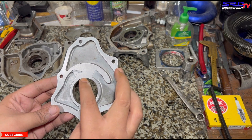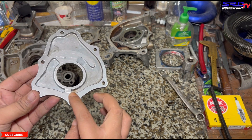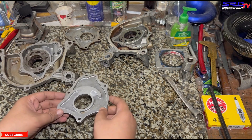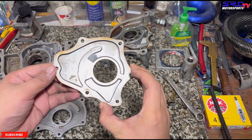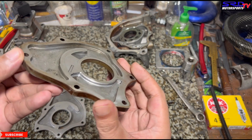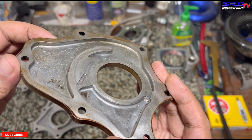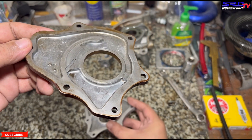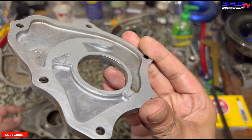All resurfaced — you can see the ridges are gone. The bottom has a deeper ridge but we didn't remove that because it would get too thin, but overall it's a lot better than before. When you get like 0.002 inches of clearance that small it kills oil pressure. Look at this one we haven't resurfaced — that's probably more than 0.002 of clearance. Adding that side clearance to the oil pump gears reduces oil flow. Compare them — the resurfaced one is clearly much better.